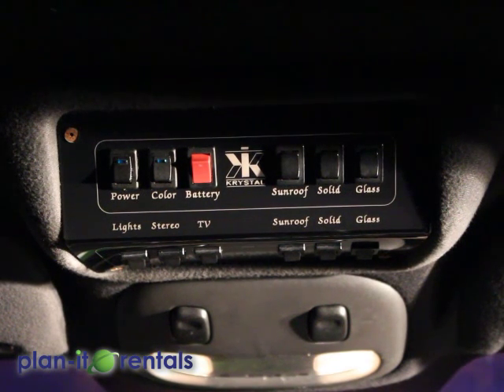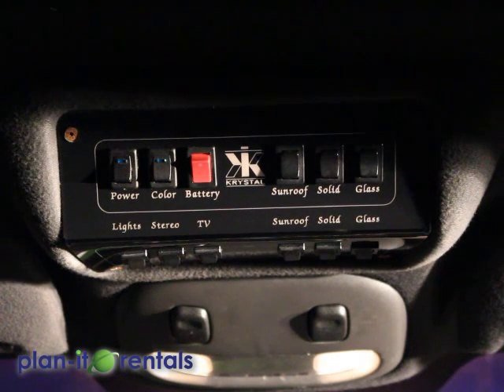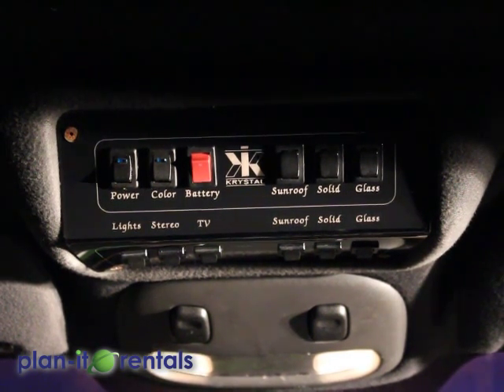One other thing to mention is the limo has a very big V8 engine. When you start it, every once in a while when it's cold, it doesn't start right up. And that's fine, it will always start. But you do need to turn off all the electronics, take the key out of the ignition, and start it again. Otherwise those electronics don't reset and allow the car to start.